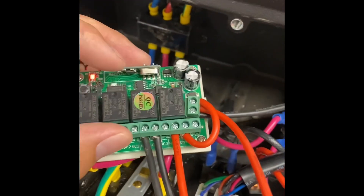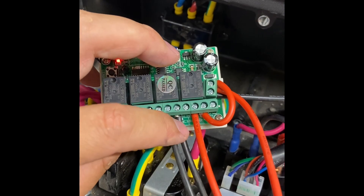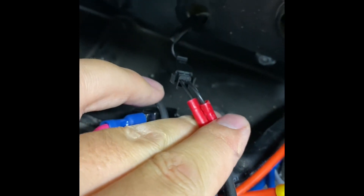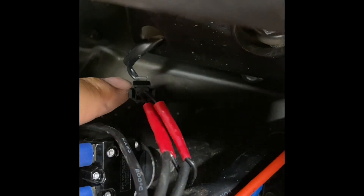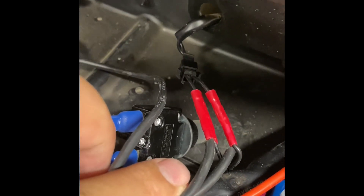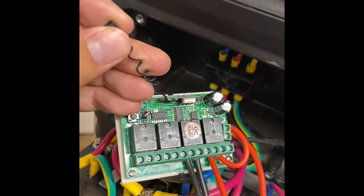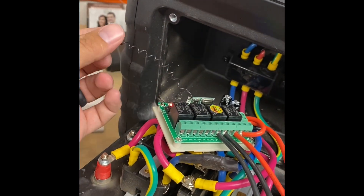Then I used B for the kill switch. You take both of these wires and splice them into your kill switch wire right here. Factory, these wires just come up and connect here — I just spliced them in, so you can still use your panel and your remote. You don't need any power for this; it's just a circuit and you open and close it. Right over here, this thing is your antenna — I'm going to be pulling that pretty far away so the RFI doesn't get messed up and ruin your signal.